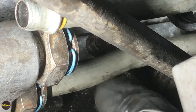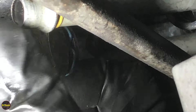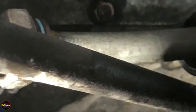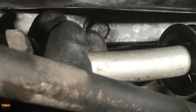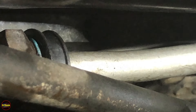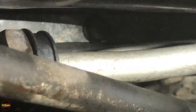Since we got the outlet done, slide the black cover over it. From the service manual, make sure we don't see any gap. Now we take the inlet pipe, position it, and push it in until it snaps. Once you're sure it has snapped into position — you can tell by the fact that you can't see the yellow anymore, and also when you try to put this clip on it will snap in flush with the fitting. As long as it snaps in flush with the fitting, you don't see any yellow, and you heard it snap, you're done.